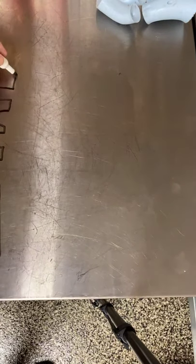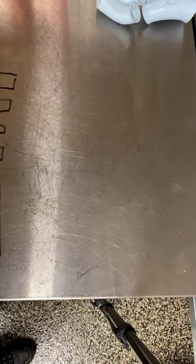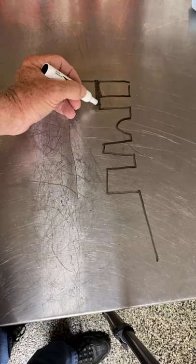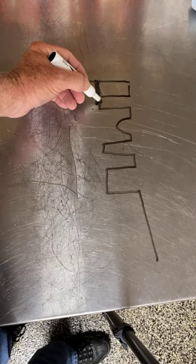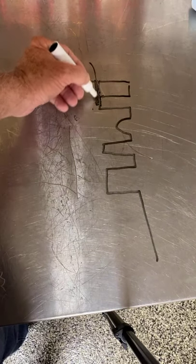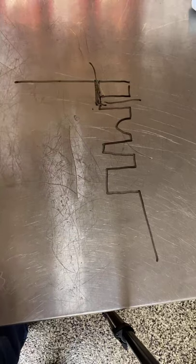All right, here's our piston. Here's our gas ports. We run top gas ports halfway the hole, halfway in the back, halfway the depth. We run our gas ports through the top, halfway down of the ring width, and halfway of the back of the ring, so that we can actually get this combustion pressure back here to blow this ring out.